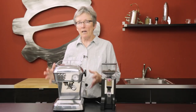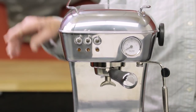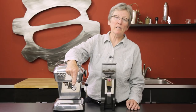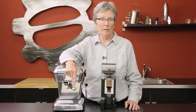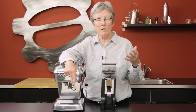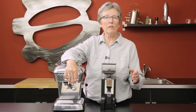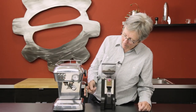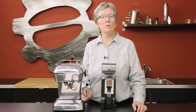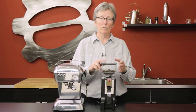Everybody loves the casing on this. This style has been around for a lot of years — they've changed little technical properties of it but it's basically the same machine. It has a stainless steel lined aluminum thermoblock boiler on the inside. It has the pressurized and non-pressurized baskets that come with it. Pressurized is more forgiving, so if your grind isn't perfect you're still going to get a decent shot. Step it up to the non-pressurized and you can get a much better shot as long as you have the grind right — and that's the key, the grind is everything. It has the panarello steam arm right over here, which is going to give you a lot of foam. Not as much control over the texturing, but you'll still get nice hot milk with a lot of foam. Stunning case — you can't beat it.